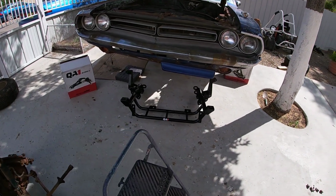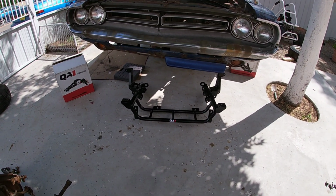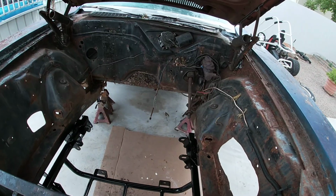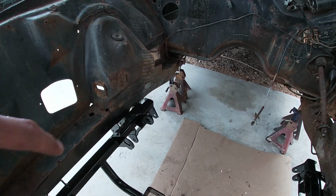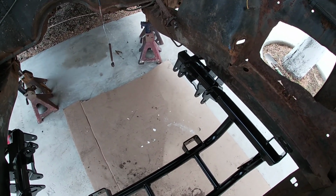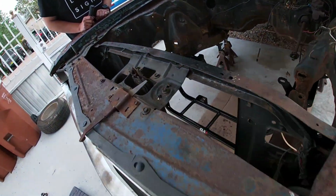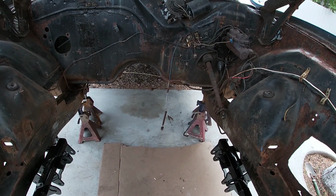And that's the main piece of the coilover suspension going in there. So we're just gonna, one of us on each side, get the bolts started and mount it on there. Okay, so finally got the piece in here. All the bolts are torqued to spec, 150 foot-pounds, and we had the little piece for the wrench here, so looks good.